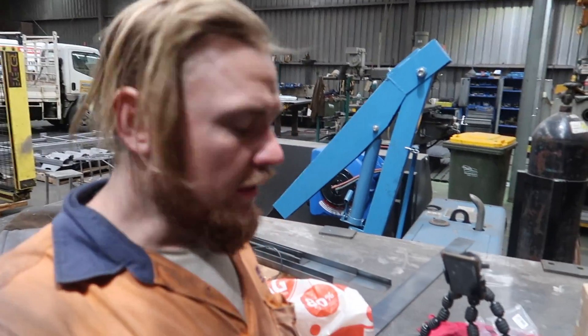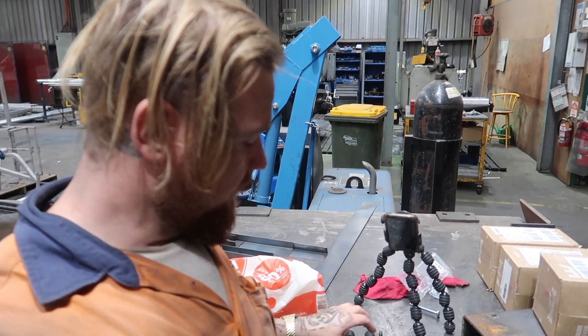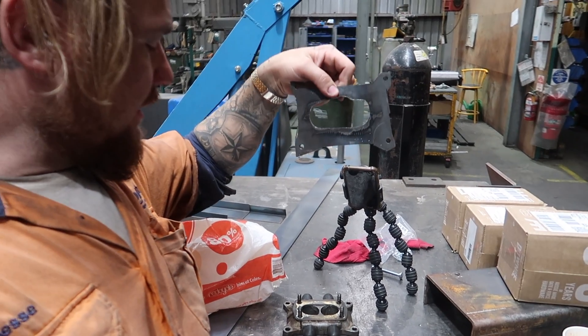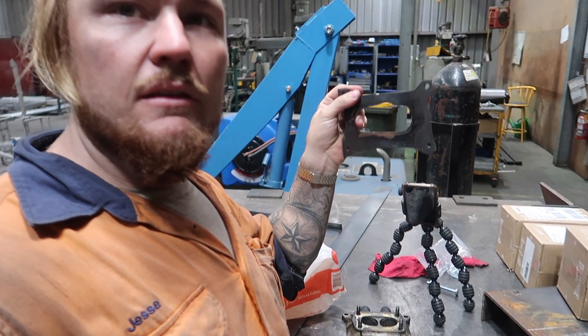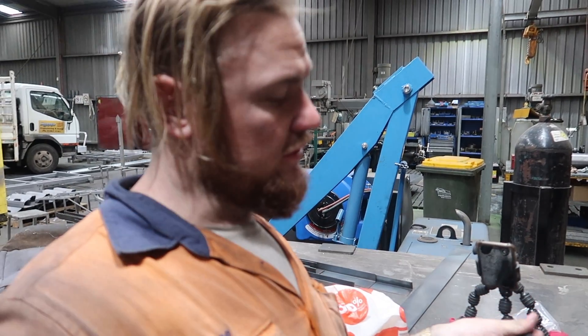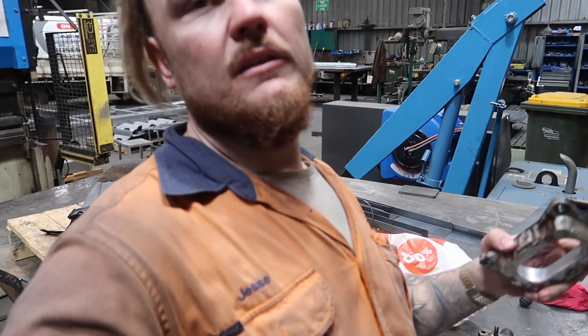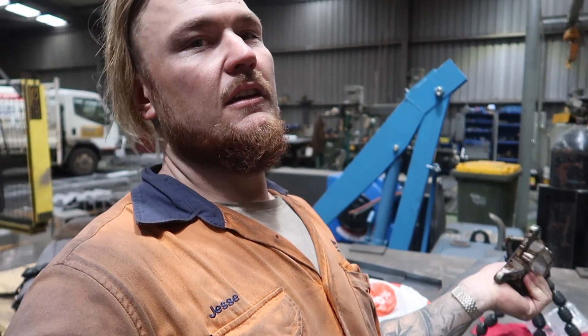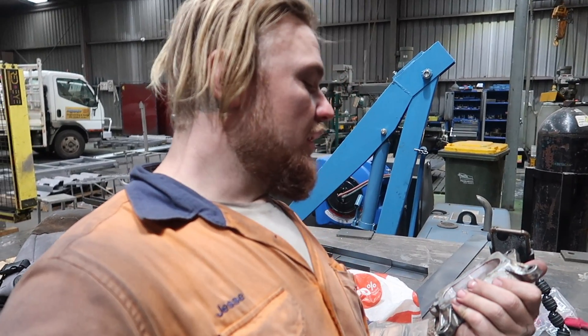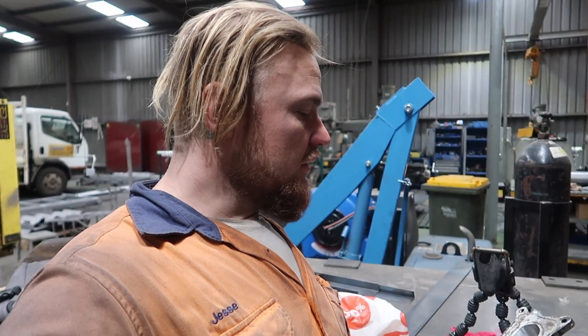Alright guys, we're pretty much at the end of this little job. I've made this slightly bigger than the hole on the head so it gives me a little bit of a lap to make it easier to weld. The thing you have to be careful of is using the countersunk bolt so you've got a flat face that doesn't interfere with the gasket - probably not ideal but it's the only real way around it for the Lynx adapter kit. Once this is done you can pretty much put any larger carby on really, because the adapter kit is pretty universal.